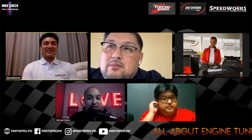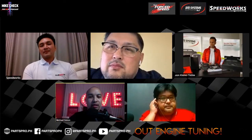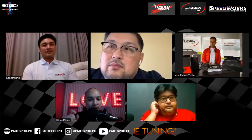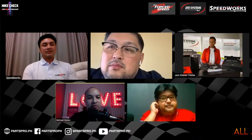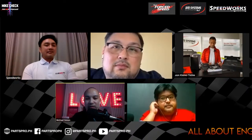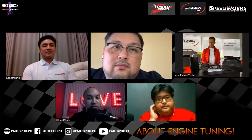Yeah, that's one nice thing with a custom tune. If somebody's got this kind of intake, or wants to run this kind of fuel injectors and things like that, with a custom tune you could really individualize everything to whatever parts the customer has already added to their car, which is nice. If somebody wants to run 1,000 cc injectors or a flex fuel system, a custom tune is really going to be able to extract the most power out of whatever aftermarket parts they've gotten for their car.